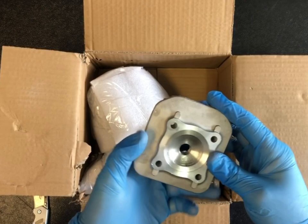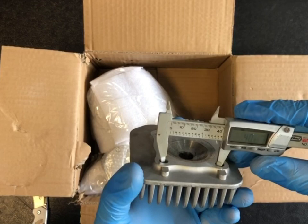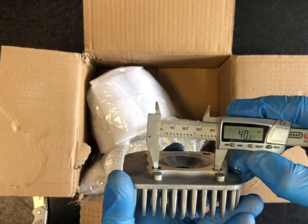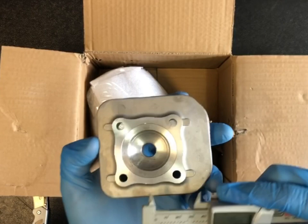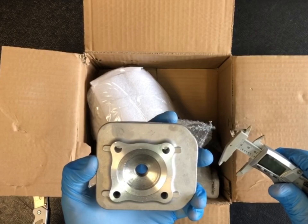As you can see right off the bat, we're looking at a genuine Minarelli top. This is not an 80cc top with M8 stud hole spacing — this is made specifically for the Minarellis. We're looking at a 40 millimeter square pattern with M6 stud holes, not M8s. The engine comes with the M6 studs already pre-installed.